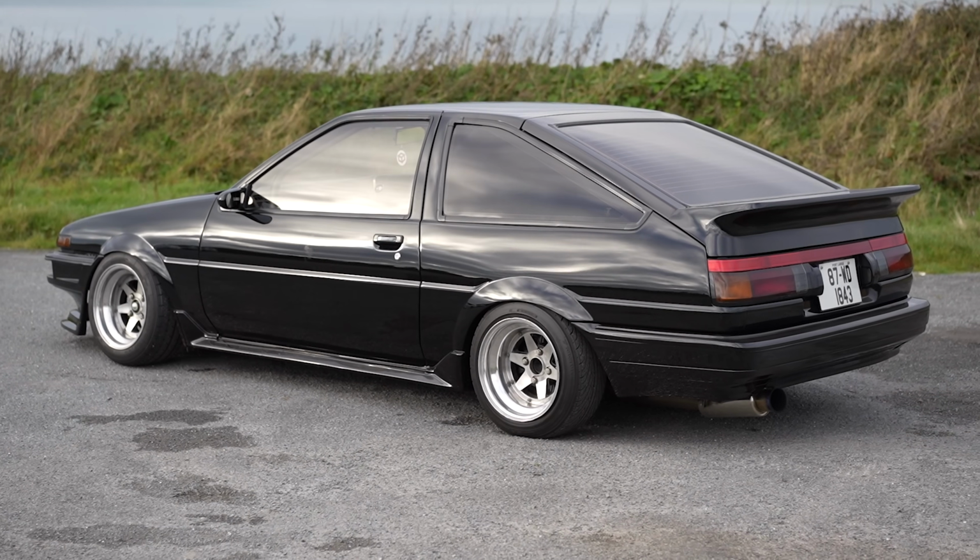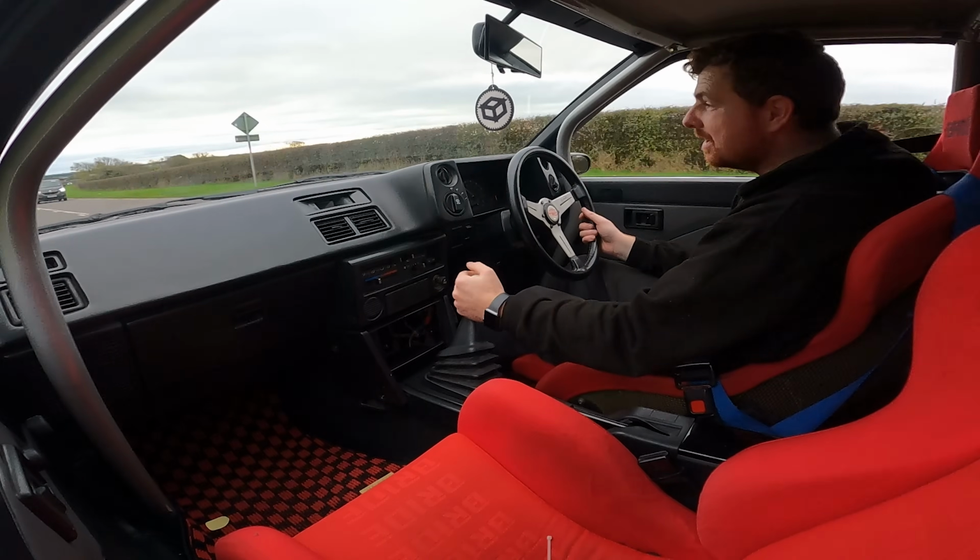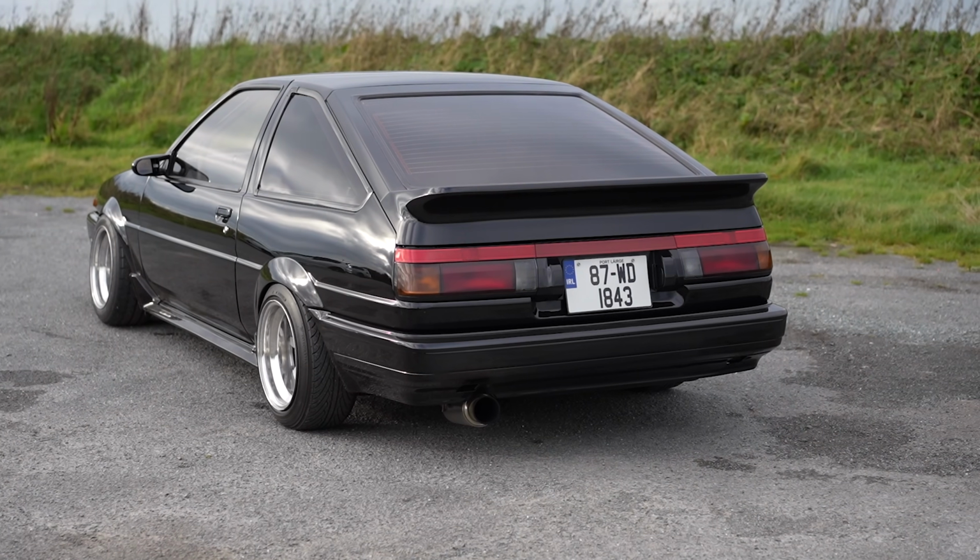So ironically, the only part of the car that we didn't take apart when we were restoring it was the axle. Because I was told it was in good condition, and Dan probably just didn't remember. But yeah, the second we went for a spin, got the car over 40 kilometers an hour, it started making an excruciatingly loud noise in the rear. And the thing about a whining noise with the crown wheel and pinion is, if you don't fix it, it just gets louder and louder and louder. And I've driven the car up and down to Mondello for 86 Festival, LZ Fest, all these things. So I've just made it worse.